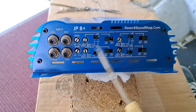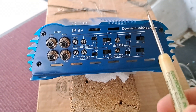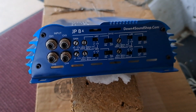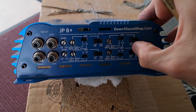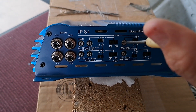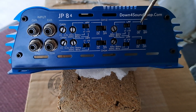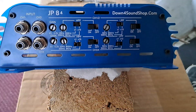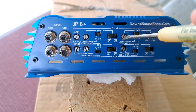A band-pass filter allows you to play from one frequency set point to the next. So we have our speakers set at 100Hz, and they'll play everything from 100Hz up. Turn our low pass filter on and set that to 800Hz — now that speaker is only going to play from 100 to 800Hz. And if you wanted it to play higher than 800Hz, you just turn your multi switch on and you can allow it to play up to 8kHz.